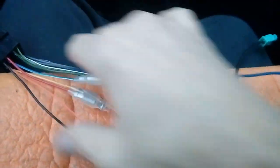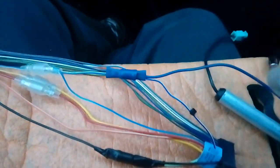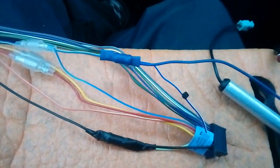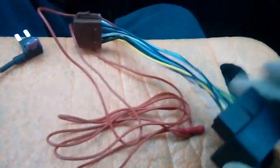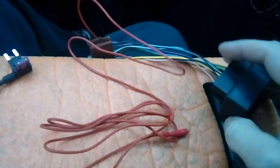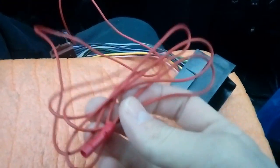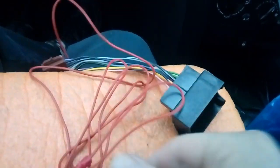Now we're going to loom all this up so it's nice and tight. There's one extra wire to do on a Peugeot — if you're on a different model you probably won't have to do this, but on Peugeot and Citroën you do. This is your wiring adapter — quad lock connection on one end and normal ISOs on the other. You'll also notice a red wire that comes off loose — this needs to connect to an ignition switched live at the fuse box.